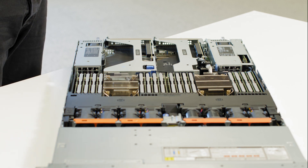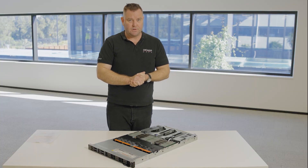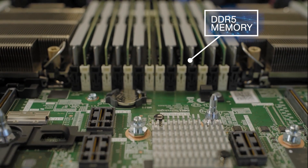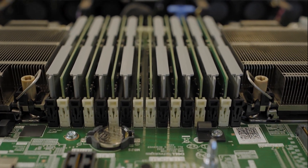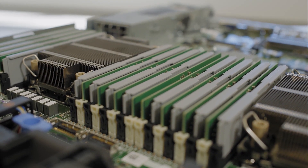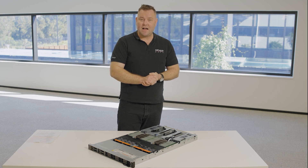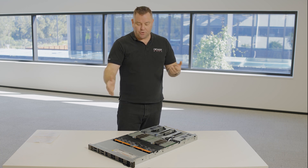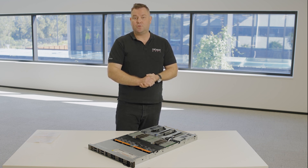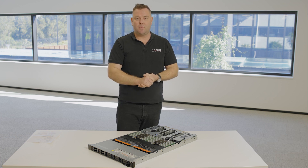Specifically around the 16th generation server — what makes this one different to previous generations? I have to admit, it's more of an evolution rather than revolution. The biggest difference in this generation is that we've gone up to DDR5 — that is by far the biggest change. DDR5 brings a lot of advantages in making the server as energy efficient as possible. DDR5 RAM is more efficient than DDR4 and is also twice as fast. If you choose to go down the DDR5 path today, you do have that peace of mind for longevity — DDR5 is the new normal in servers, and the next couple of generations will all be running DDR5.